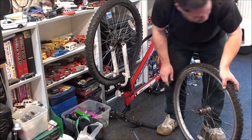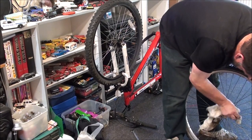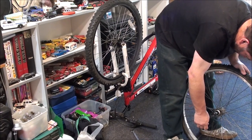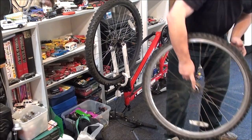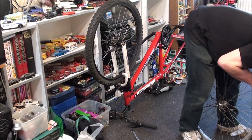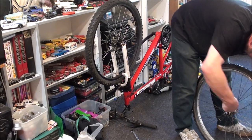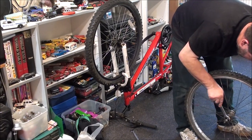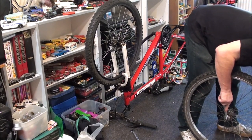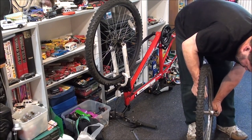I brought out the best tool for the job, so I brought both. Maybe someone's had a play around with this wheel. I need to back that bearing cone off just a smidge because that axle isn't even spinning. I can't remember — that's a 16 or a 17. I know that nuts are usually 17s, but bearing cones are usually 16s.